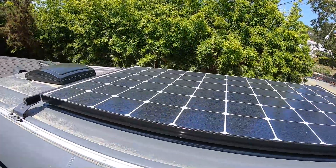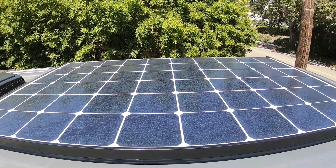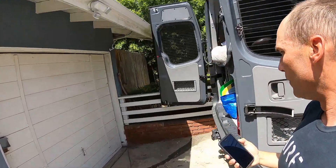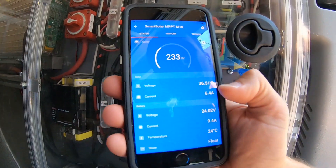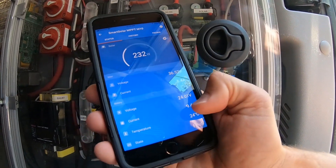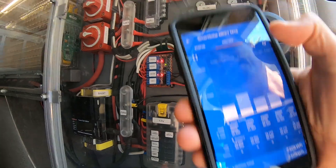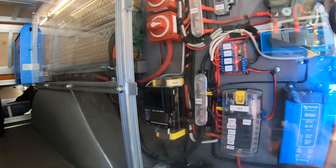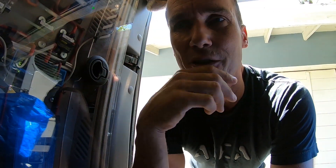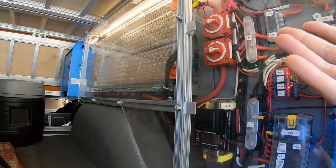The solar panel up on the roof is currently producing 36.5 volts at 6.4 amps, and the solar charge controller converts it down to 24 volts. It's already in float because I have the battery set to max 24 volts — it doesn't take any more charge right now. The battery can safely go up to 25.2 volts, and on discharge I stop at about 21 volts, though I could go down to 19. I keep the battery in the mid-range because I have a lot of power and usually don't need that much.